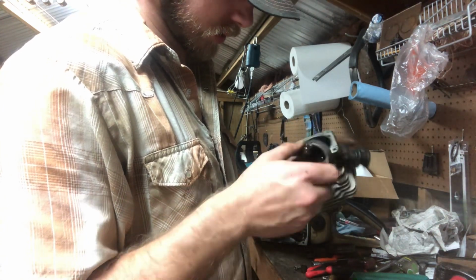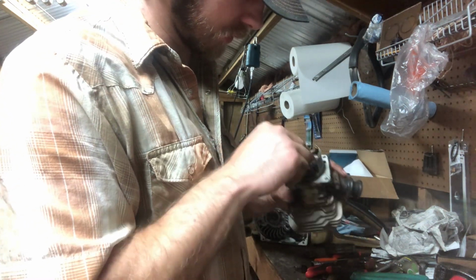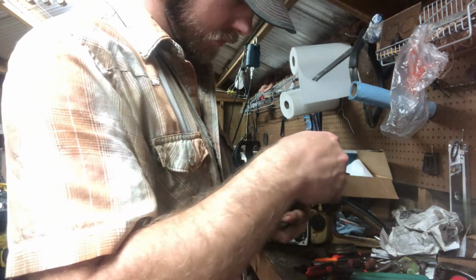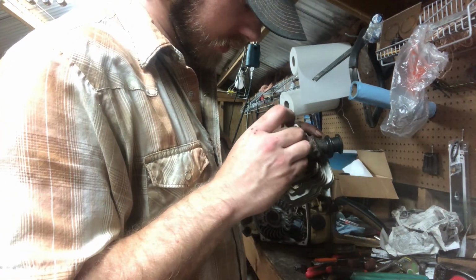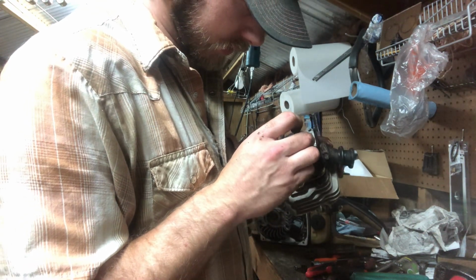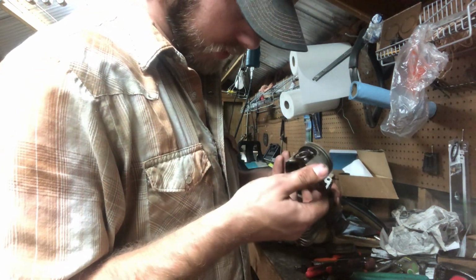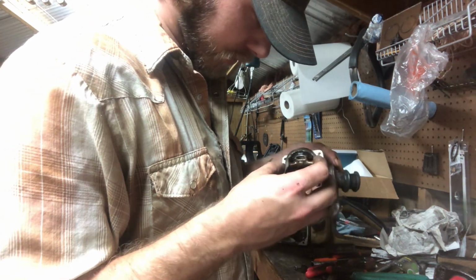Goes to the intake side. I mean, real tight. Cattywampus or something. Yeah, it doesn't want any part of this. Once it gets up to the rings, it doesn't want any part of it. And the rings are fully seated in there. So I don't know what happened to this thing. Is the piston deformed? Or somebody threw the wrong piston in this guy.